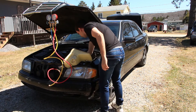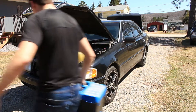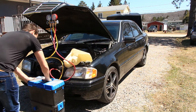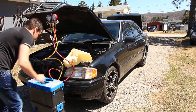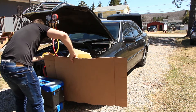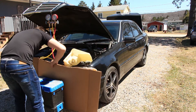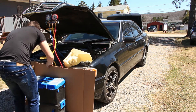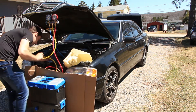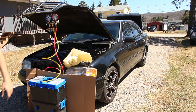The reason I ask whether it will work in the Mercedes is because the AC is far more complex for a couple of reasons. It uses an expansion valve to meter the refrigerant and it has a variable displacement compressor which varies its output based on low side pressure. If this gas does not behave like R134A then it might not give good cooling performance. But if it does work, then it's basically guaranteed to be a drop-in replacement for any other type of system.